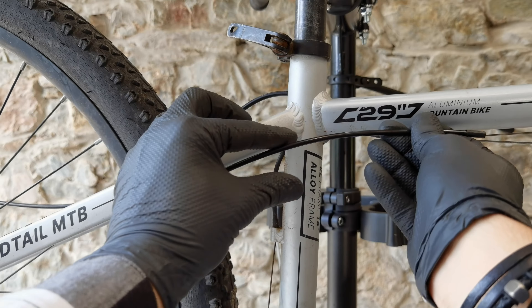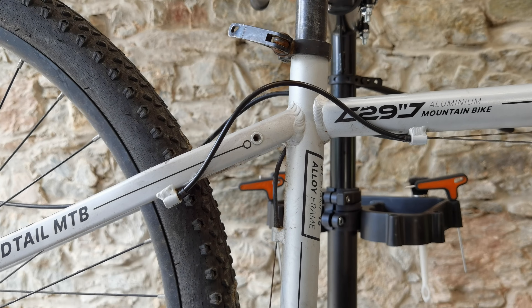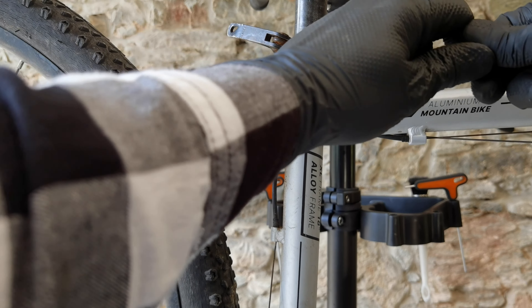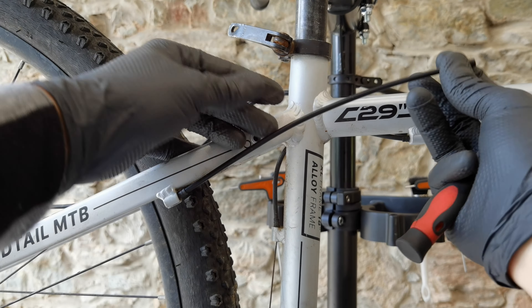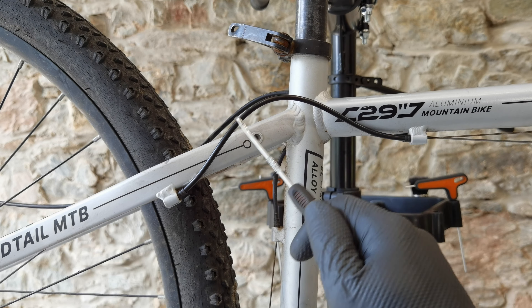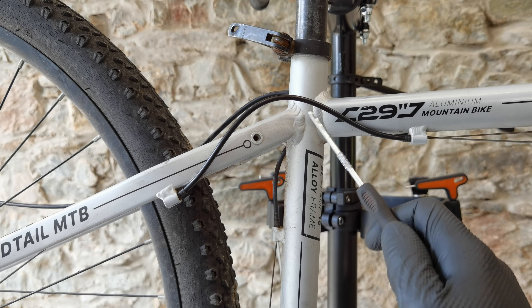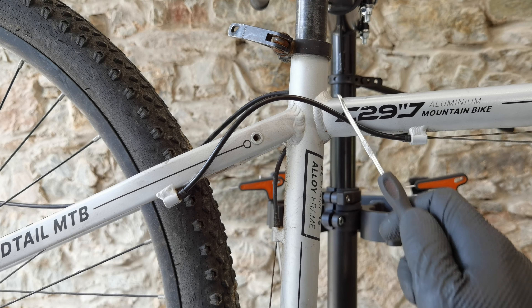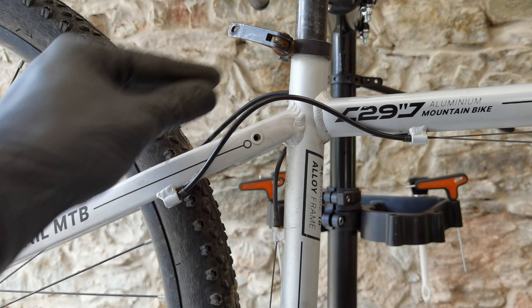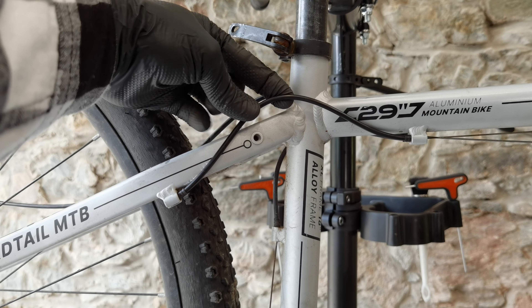Two new endings. It might be a little bit shorter, so I'm going to cut it, remove the ending. I like it now. This is where the cable will be rubbing against the housing. If this was shorter, you would have more surface where the cable actually pushes against the housing, and the housing is still very stiff. That's my take on it.